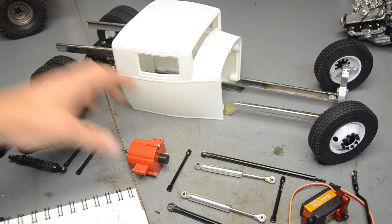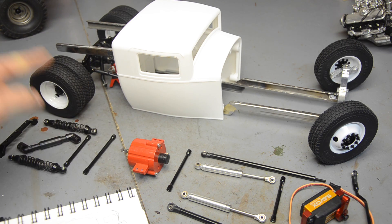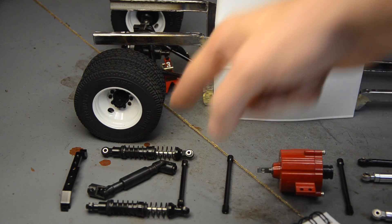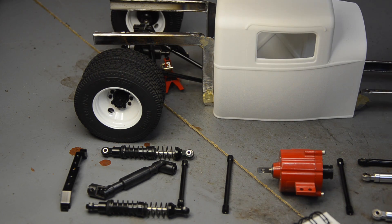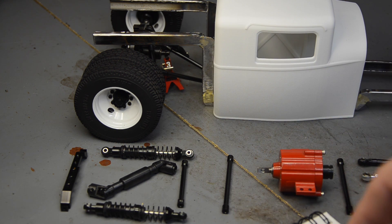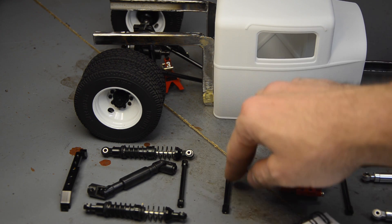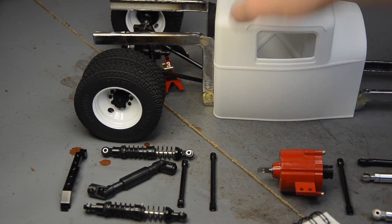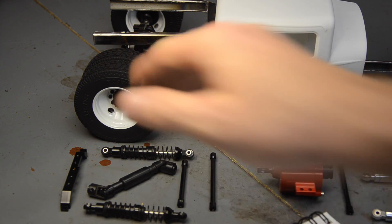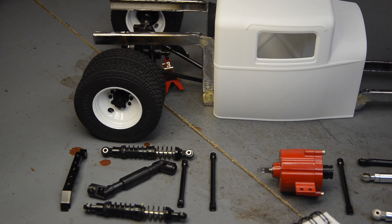Moving on to the back — this is going to be the bottom of where the frame Z's up in the rear. The frame Z — that's what they call it when you do a big step like that on a chassis. There's going to be one at the top as well, which will share a lot of things: that's where my upper shock mount will go and hopefully where my upper 4-link mount goes. The lower 4-link bars will mount either inside or outside the chassis there. This is kind of the wheelbase I was shooting for — I've done a lot of pictures just trying to get an idea of the look I want.